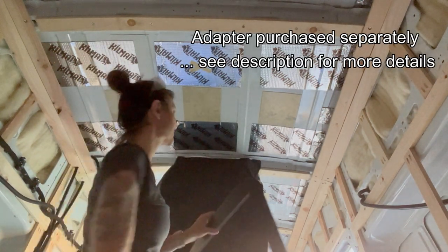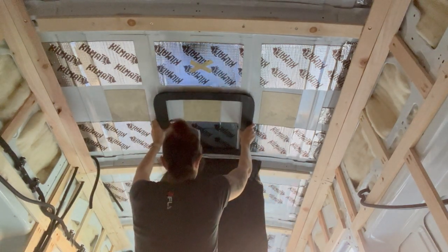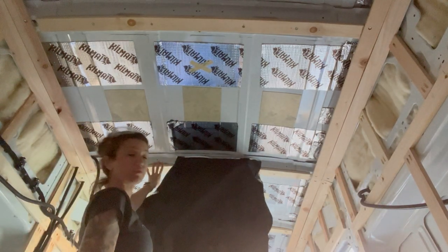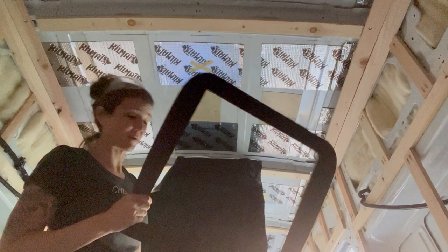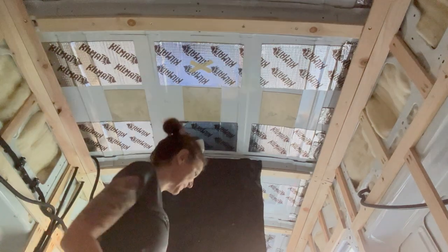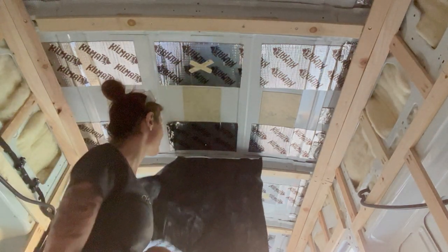I'm ready to tape where the hole is going to be, but first I need to use the adapter to figure out approximately where it's going to go so I can drill a couple of placement holes and take it up to the roof. I'll drill a hole at the farthest forward point, making sure I still have space for the mount underneath and that I'm not too close to this beam. I'll draw the outline on the roof rather than figuring it out from below. I have kill mat here that I couldn't pull off cleanly, so hopefully it won't affect the jigsaw. I'm taping it up to catch shavings and then we're heading to the roof.